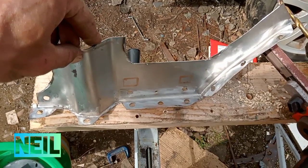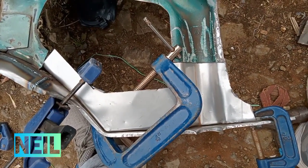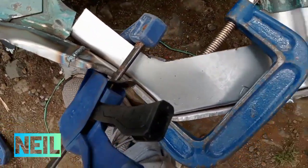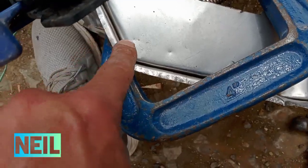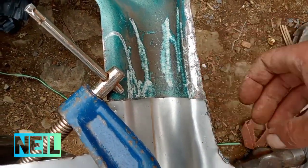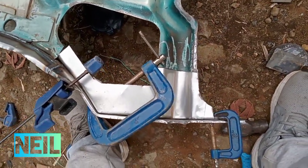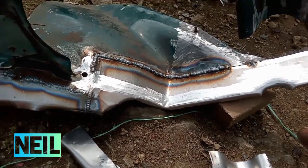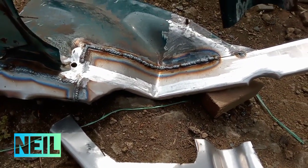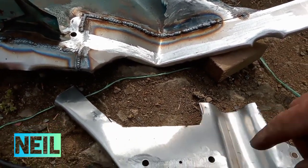And there I've drilled all the holes for the spot welds and for the clips for holding the wing on. This corner is nice and tight, happy with that. And the curvature of this bit is working out not too bad either. So happy days. I'm just going to have to try and form this bit around a little bit more and that's it. But for the first dry run, I'm very happy. I've given it a clean up with the finger sander in preparation for spot welding it on. I've done the same with these ones. So I'm going to give this bit a quick coat of weld-through primer and then I'll go about spot welding it on.